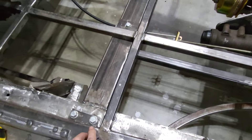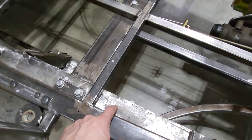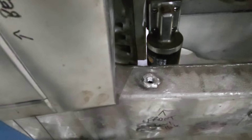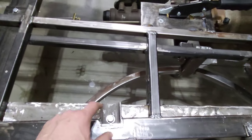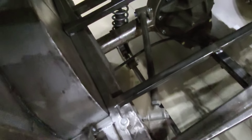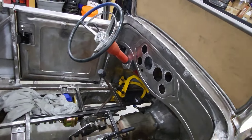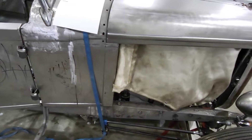I can't even remember how many bolts I did, but what I did is I used flange nuts and welded them into the frame — that's how I bolted the body to the frame. There are a few of those running all the way down and on the sides, two on the sides and on the back rails. So we're gonna strip this apart and I'll be able to finish underneath the frame.